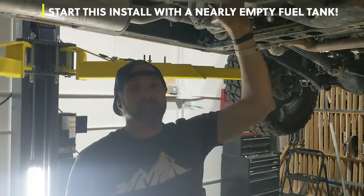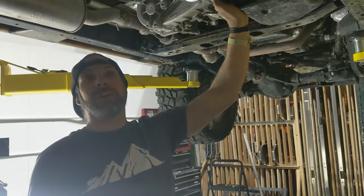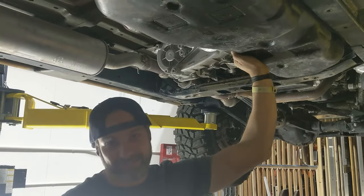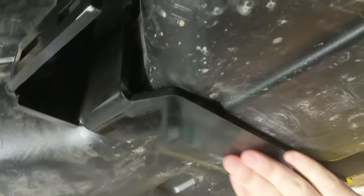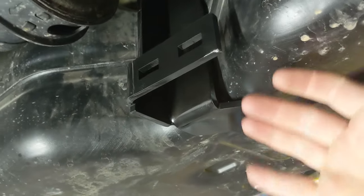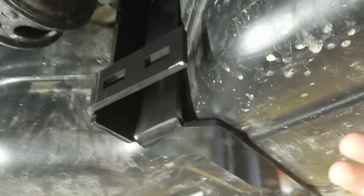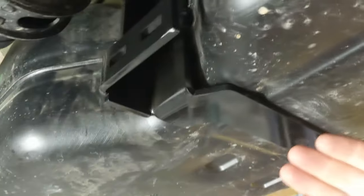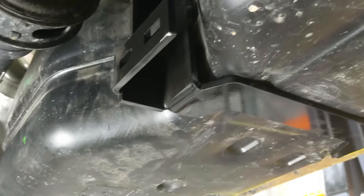The hardest part is doing the gas tank. What makes it the easiest is if you do it with the least amount of gas as possible — you want the gas light on so you have as little weight hanging over your head as possible when you do the gas tank. You need to paint your brackets first. You're going to notice in this video we've got some nice shiny black spray paint on a lot of our brackets. We are looking at options to coat, zinc plate, and powder coat all of these brackets before they even get to you guys, but right now we don't have that ability in-house and we really don't want to stack on any more lead time. So when you get these, they are likely going to be bare metal. Do a little bit of paint prep — get some spray paint on there, or take them to your favorite powder coater down the street. Otherwise, these steel brackets are going to rust.